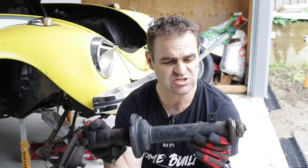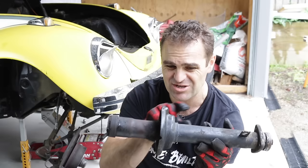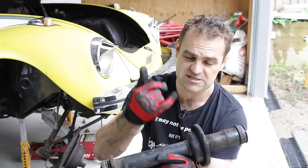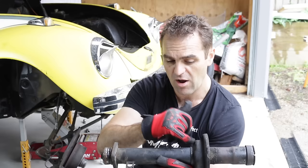I've got these off and cleaned them up with a bit of brake cleaner. Now it's time to work out how to lower them. I've seen methods where you cut a piece out of the tube and weld it back together shorter, but what I'm going to do is cut the weld off around the base of the spring perch, slide the spring perch down further, and re-weld it lower. First I'll mark a line down the edge of the tube as a reference so the spring perch goes back on in the same orientation and isn't twisted.